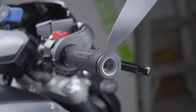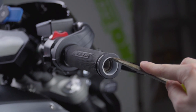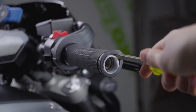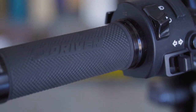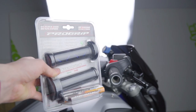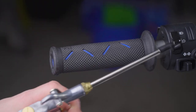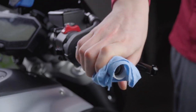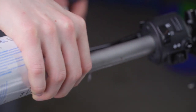Many people usually cut off their grips, but I like to preserve them just in case. To take them off in one piece, I use some WD-40 and a flathead screwdriver. I use the screwdriver to peel off any glue and make a small gap so the lubrication can make its way all around the grip. Then simply twist off the grip and it should come right off. The type of grips you're running on your bike can greatly increase the confidence you have in your motorcycle. After trying a bunch of grips, I have to say sometimes the cheaper option is better — these ProGrips offer the perfect thickness and grip. The grips shouldn't go anywhere after the alcohol evaporates.